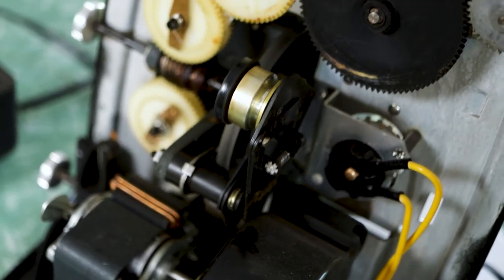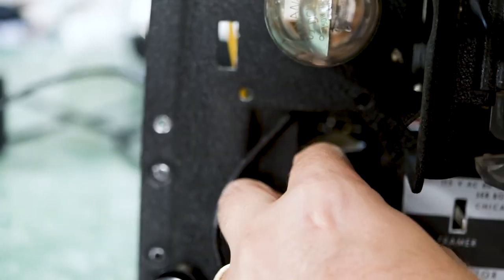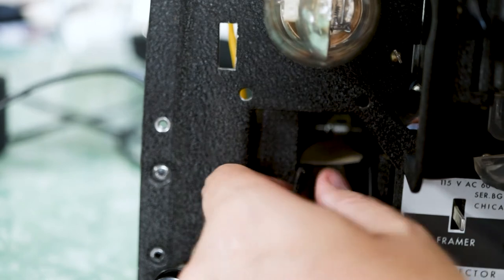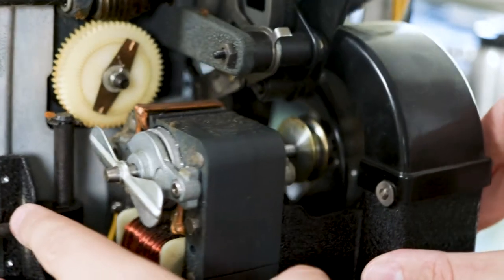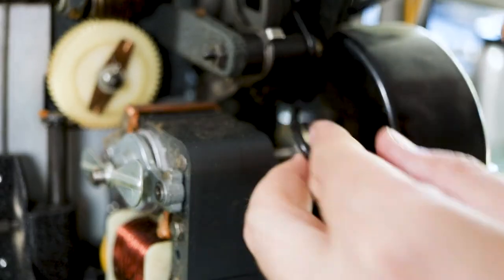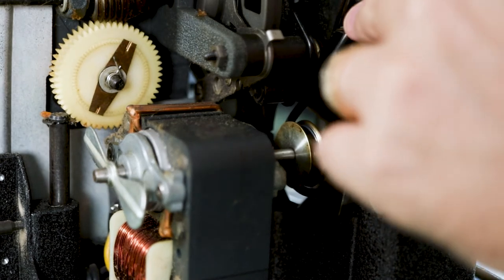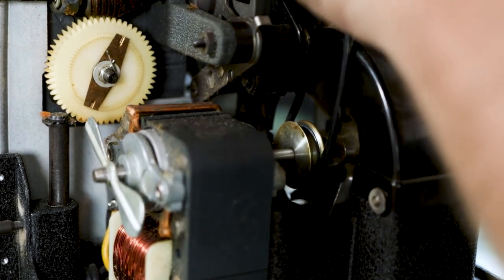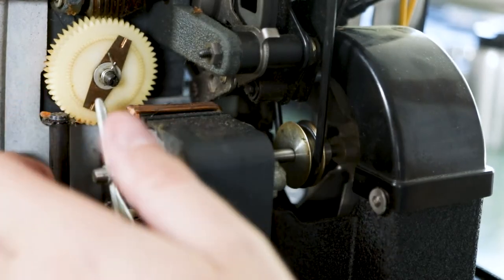Hopefully that will be relatively easy - famous last words. How we're doing this: got the belt, I'm going to get it kind of hooked on one of these fan blades and just sort of spin the fan all the way around until it's just on the spindle. Should be able to turn this around this way. Grab it over here - look at that. It's like I know what I'm doing. Almost. As hopefully you can see, the new belt is happily on there.